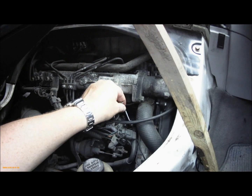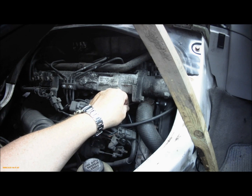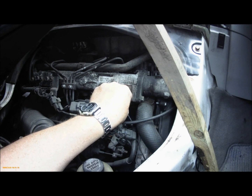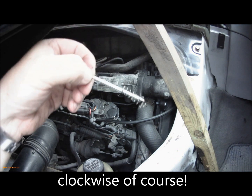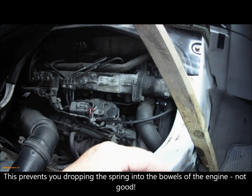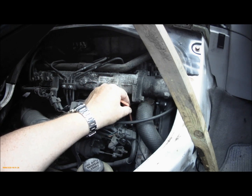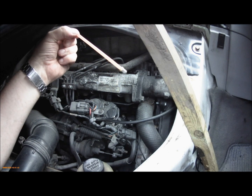Now, take your wood screw, drop it into the hole, raise it up slightly and then drag it up the edge, and that will extract your screw, your spring, and then turn it ever so slightly and it will grab into the spring and bring your spring out. Next, take your drinking straw, drop that in, push it down until it's seated, carefully drag that out. That extracts your Banjo filter.